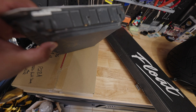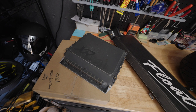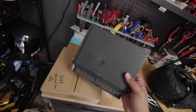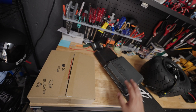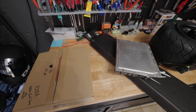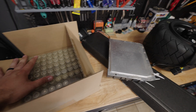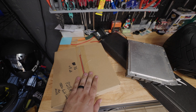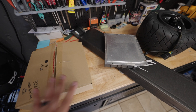Coming to the rear, this is an old XR battery box that I bought from the Onewheel Facebook marketplace because I didn't have a spare one. Rather than use the stock battery or buy one, I'm going to build my own. These are Molicel P28A cells — I got a few cases of these — and I'm going to build a 20S2P battery to power this board.